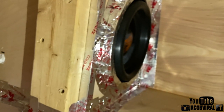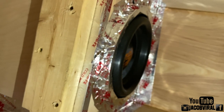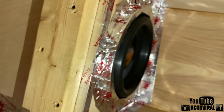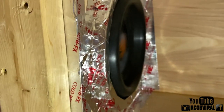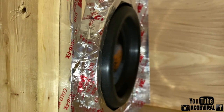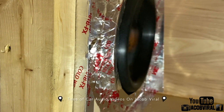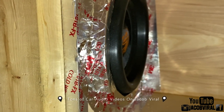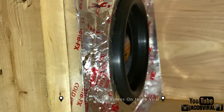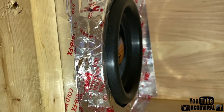It's low volume so you're not going to see very much flex because I have the subsonic up, but that's okay. You can see how the subwoofer is moving quite a bit there - that means I know I'm not near my frequency peak. As you get closer to your peak, you're going to notice the subwoofer moves less and less. That was 33 Hertz.